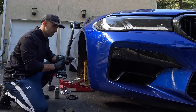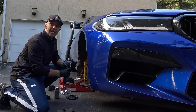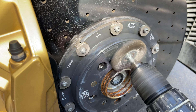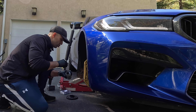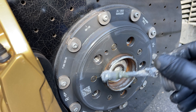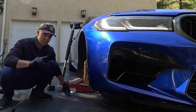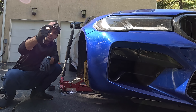I'm also going to link it down in the description. You basically put it on the end of your favorite drill and clean the hub. Now that you've cleaned the hub, you want to get some anti-seize and put just a tiny bit on the actual hub. You don't want to go too crazy — just a tiny bit on the lip. Then you slide your favorite spacer, make sure it aligns with the wheel bolts. Keep in mind that if you get spacers, especially anything over five mil, you have to get extended lugs or bolts.